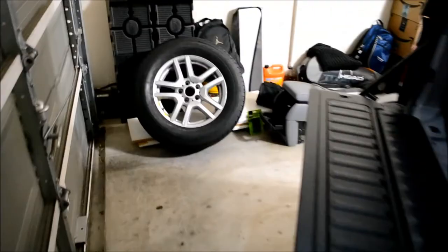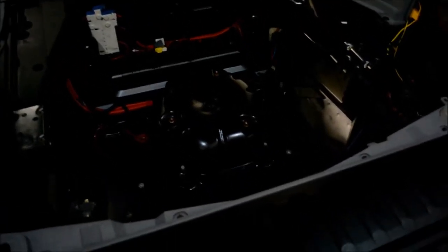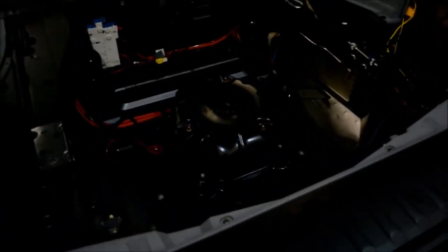All right. In the back, you'll remove the lower cargo tray. The two side panels, they just clip out. And then if you have a spare, you'll remove the spare. And you'll be left with the air pump, if you have rear axle air or two axle air.